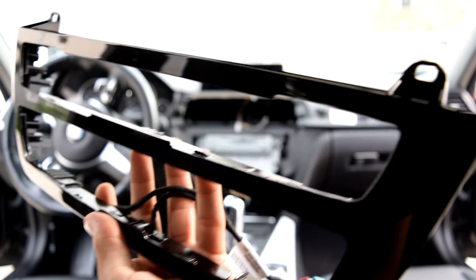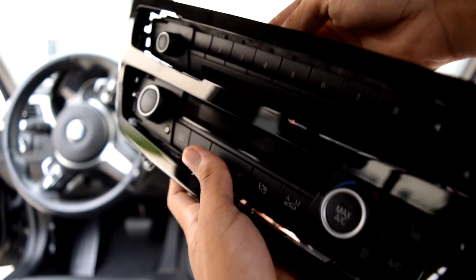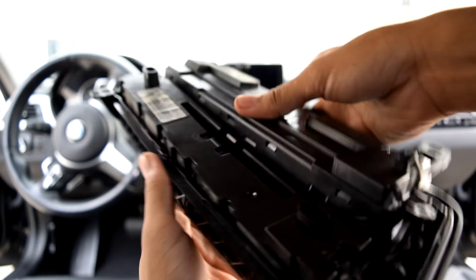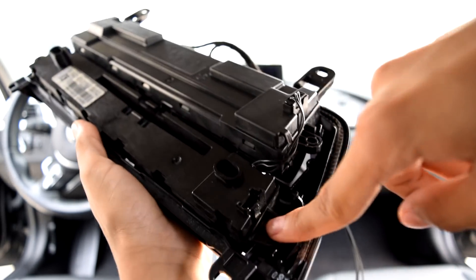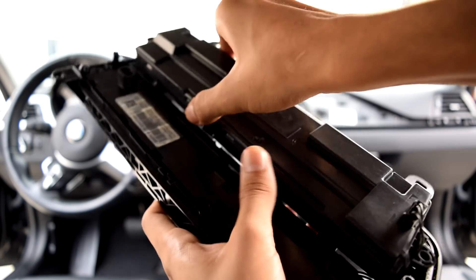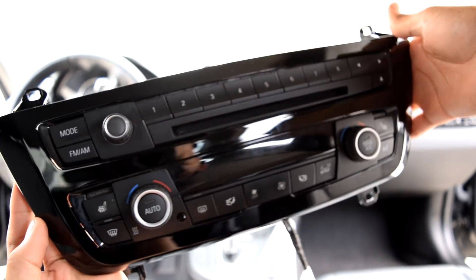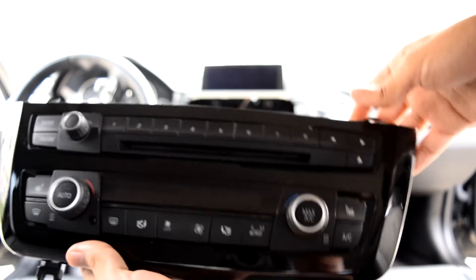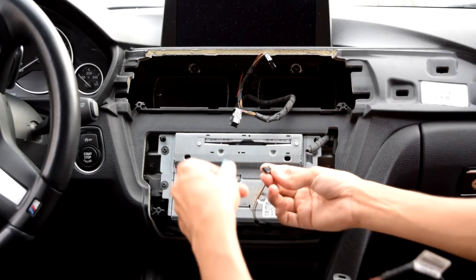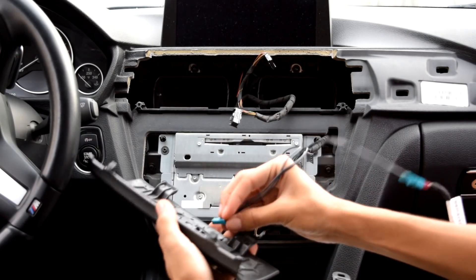Now go ahead and grab your new trim piece and place your old radio and climate control back into it — just basically push them back into place. It shouldn't be too hard; everything just has to line up and clip in. Flip this over, make sure these little things line up over here and here, push down and you should hear it clip in. Do the same with the climate control — just clip it right in. Once you hear that — boom — this is our new radio piece. Check that out, look how nice that looks! Now, once you've got the trim piece on and everything lined up, go ahead and connect these connectors — the male end goes into the female end like that.